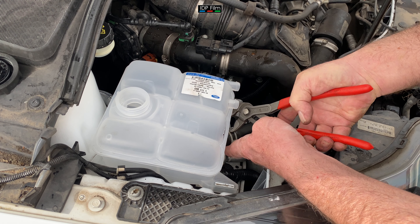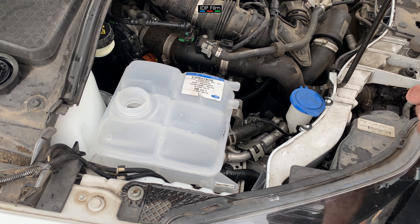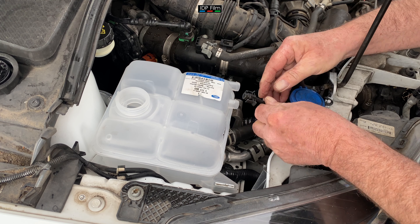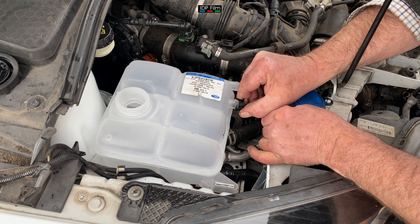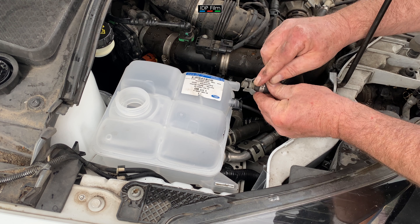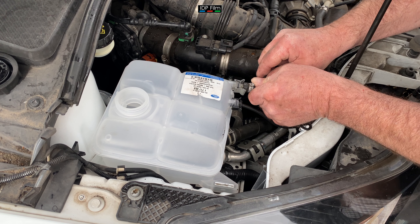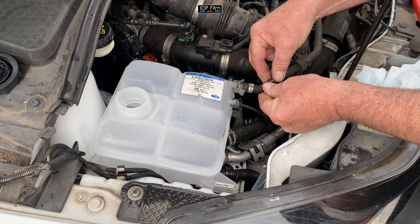Getting the clip back into the same position as it was before. Very tight these are - she's on. Right, double check that's on - that is on. That clip there - make sure it fits on. Two clips you pull together, push it on - clips into place. Check that one - they've gone exactly the same. Two clips with a rubber seal on there, so I'm going to put some silicone on the rubber just to help it. Push that onto there - that clips on. Double check the bottom feed hose is in - that hose is in. The turbo pipe for the coolant is in. Check the top - that's 35 pounds for that top, nothing wrong with it at all. Just make sure it fits - it is.